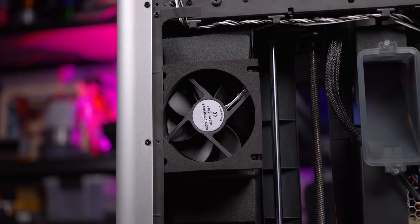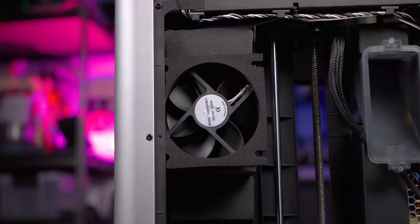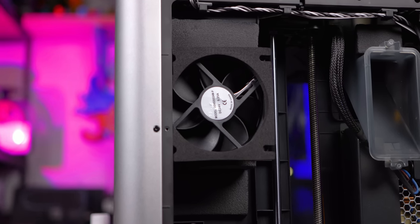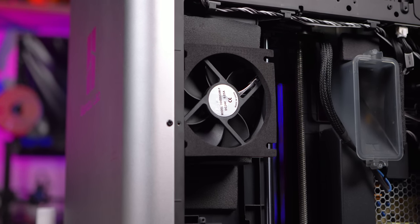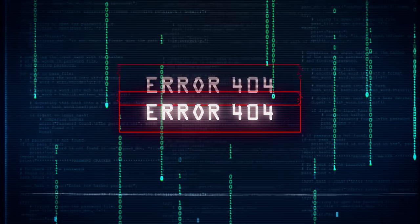This tells me the original fan was probably a 4000 RPM fan, because 1600 would be 40% of that. There's no information available for the fan that was in here — the part numbers on the sticker all seem to be Bambu-specific. To my knowledge, this is not and will not cause a problem. I haven't seen any error messages, and nothing has indicated the machine is going to say it's only getting 40% and stop the print. But I'm not saying they couldn't update the firmware later to make that happen.